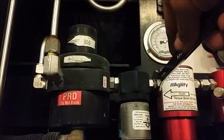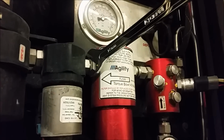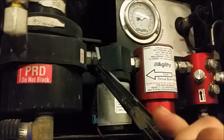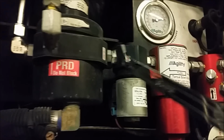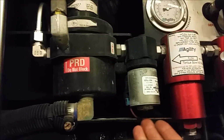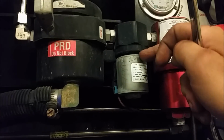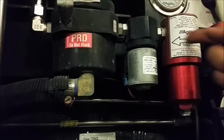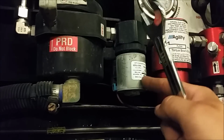And this, oops, damn air compressor, fits right in there to where I can actually get enough bite on these lines, just enough to loosen them up, and then I can get in there with a stubby 11/16, hopefully, and do what I need to do in order to tilt this out a little bit. We got a wrench that we ground down so we could just remove this instead of having to take everything apart to replace the whole thing, because that's the solenoid itself that goes bad.